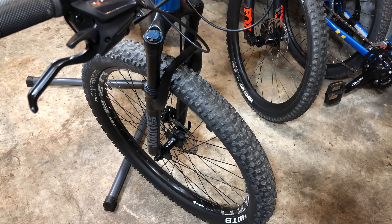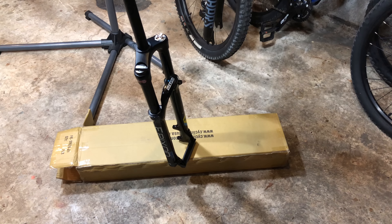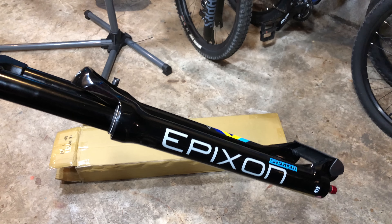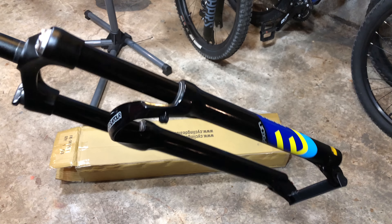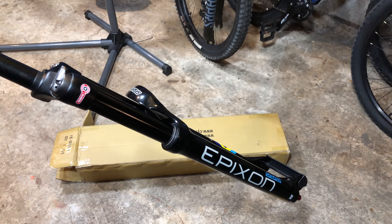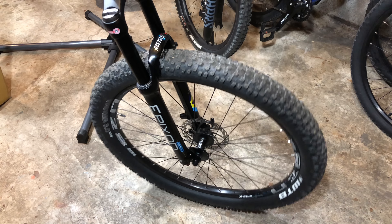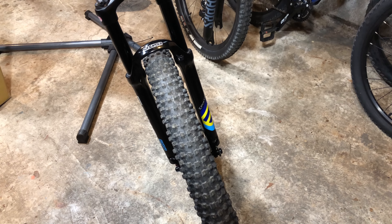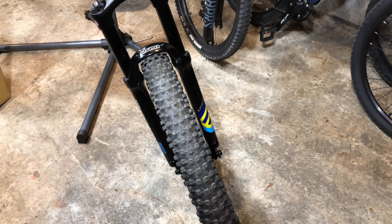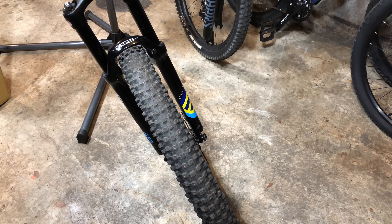But remember, I didn't plan this build out with these wheels on this bike, which is why I'm going to do an early reveal. This is the fork that I bought to use on this bike. This fork was already en route when I decided to try out these plus-size wheels. This is a standard size 29er air fork, and it should be a great fork. I'm revealing it now because someone asked me in the comments what fork I was using, and I told them — and then they mentioned that they had bought one. Congrats on that, but let me show you something first. I have no idea if anyone is planning on using this fork with plus-size wheels, but just know that clearances are tight. It's a much tighter clearance than the factory fork, but for me it's enough — I've ran even tighter. But I know people that would have a problem with this spacing, so keep this in mind if you plan on buying a Pixon and running it with plus-sized wheels.